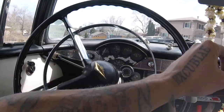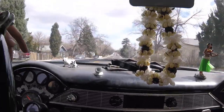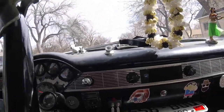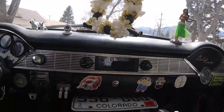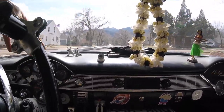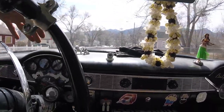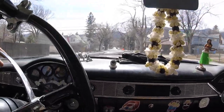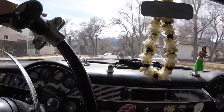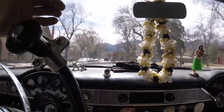Now that I have the Jeep hooded and operational, I intend to park the car in the back garage and do the airbags. I'll have the Jeep as a daily — I'm always at home, but if I need to take the dogs to the vet or go get some ice cream, I'll have the Jeep. The plan is to pull the car into the back garage as far left as I can, pull the front clip off, pull the body off and set it to the right. That'll give me room to do the C-notch, the 4-link, the airbags on the frame, and room to do the chop and channel on the body.